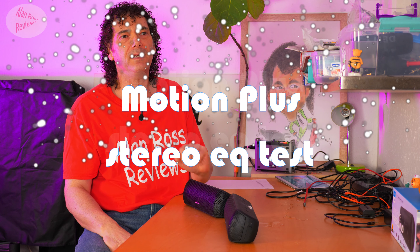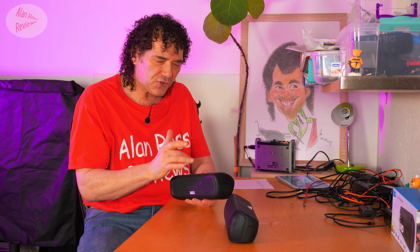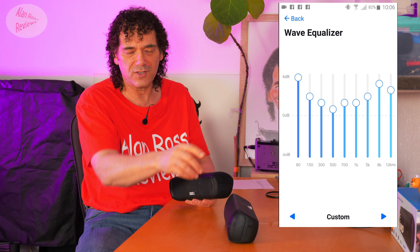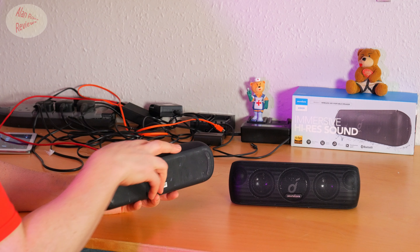The Soundcore Motion Plus Speaker. So on previous firmware, version 33-something, there was this bug. You put the two speakers into stereo and they were stereo locked. You then set your master to custom, hoping that your slave speaker would pick up the custom setting you already had in your master. The problem was it was going to bass off mode.